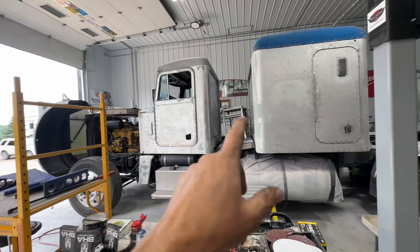Don't worry — if you don't have any experience, it's worth trying. I'm a firm believer that if you respect the process, you can get a decent job out of it. My biggest learning on snowman was probably the fact that you have to respect the flash-off time. So when I put the first coat on, I got excited and it was wet, so it looked really good. I went and mixed up another batch and off I go with the second coat. But paint needs to flash off or release all the gases, and you've got to give that time for it to flatten out.